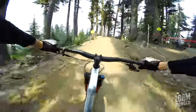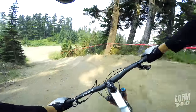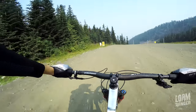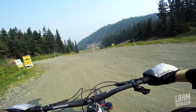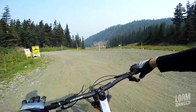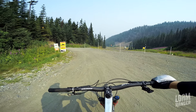It's a simple thing, but it's still a thing, is they set their sag using seated sag. So you literally just sit on the bike, take your feet off the ground for a second, and then get off the bike. And then you set the sag that way, which makes a hell of a lot more sense than trying to get up on the pedals, but you don't wanna squish in the back or in the front too much, and you want it to stay balanced, and then you got to get off really gently and carefully. I've never really understood that.